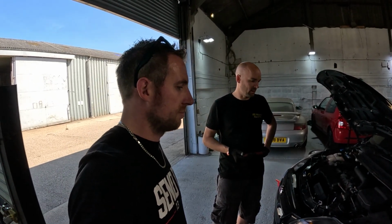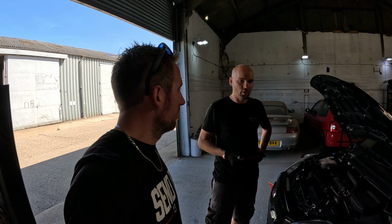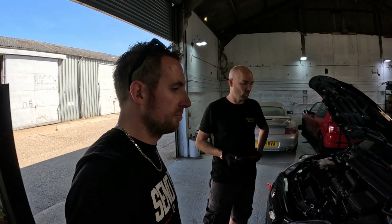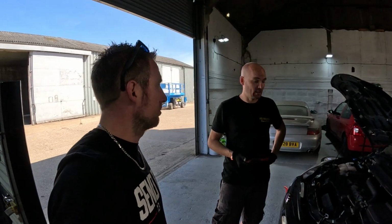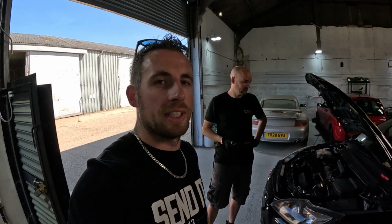Yeah. So I think the two biggest things from a handling perspective, you almost certainly want to have some more front camber on it. Yeah. And you definitely want to get some of that rear toe out of it. Yeah. After that, to be fair, it'll be really quite tunable. Exactly. And as we thought, it's a heavy girl.